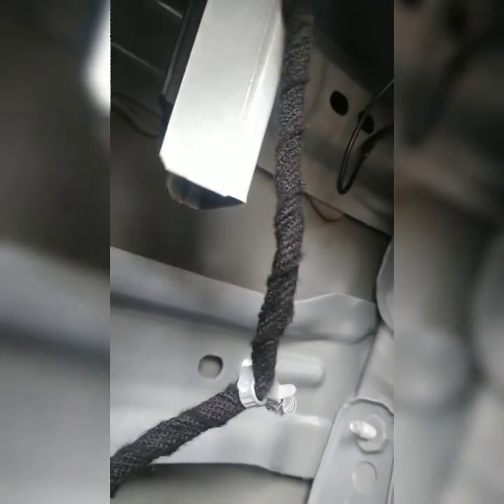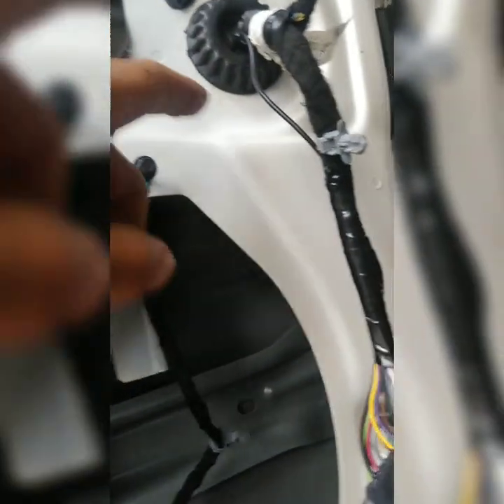I'm going to brace it here with a strap and make sure the wire doesn't get touched by the window or anything at all — make sure this is the most permanent fix I can give. Make sure you understand this catch: this wire is separate and splits into a Y. So once you make a cut here, you have to recreate a Y somewhere else so this section can also get network communication and work properly.